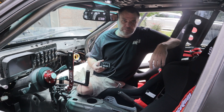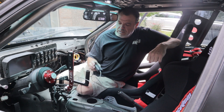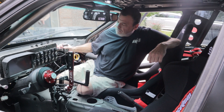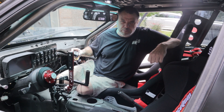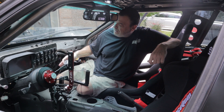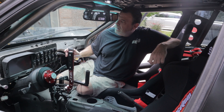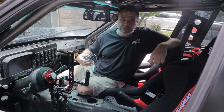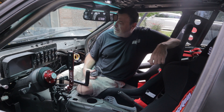I'm going to go ahead and install this piezo amp. Just to be clear, there is no mounting bracketry associated with this, so I am simply going to zip tie it to the main harness that goes across where the old dash support was. It will still be very secure. I kind of wish it had a bracket associated with it, but it's not really necessary. After that, I'll go ahead and run the wire down through the transmission tunnel where the rest of my wiring goes, and then it's going to go up and around the engine. I like to try to hide the wires on my cars as much as possible to give it the cleanest look I can.